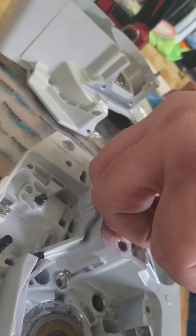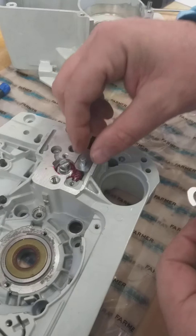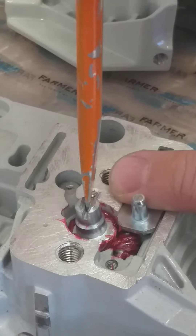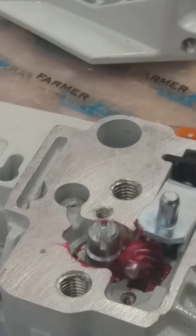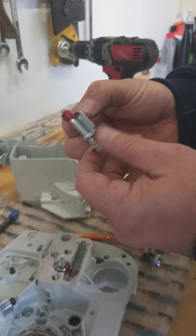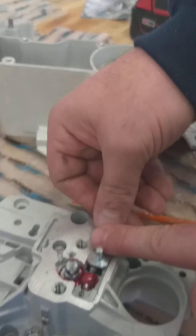That'll sit down inside there. Then we've got the chain tensioner gear retention bracket. What we'll do is get this - I'm just going to hold this bit down, there's my scratch tool - we're going to get this all in. I might actually pull that out because I've got it wound in too far. I wanted that to go back as far as I can just to get the retention bracket on. I'm not an expert at this guys, I'm just showing you what I do. So we'll just slip that all back into place - down it goes.